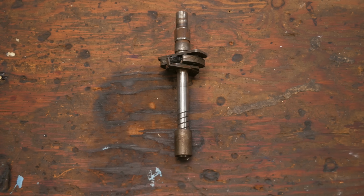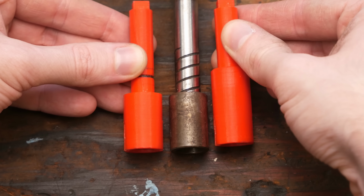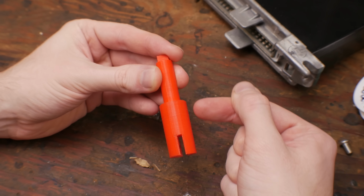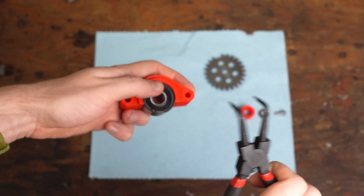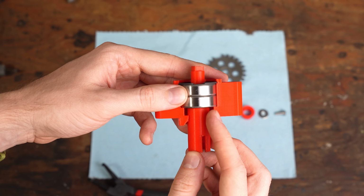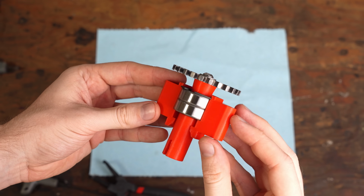Okay, I got it. For some reason, I was dead set on the idea that the base of this shaft needs to be an exact copy of the distributor shaft, but I realized it doesn't. As long as the hole in the slot stay the same size, I can make this however tall I want. So in that case, here is the final prototype. This time, bearings get locked in place with a snap ring, and the taller shoulder of the new shaft butts right up against the inner race of the lower bearing. So no thrust bearing needed, and therefore no wave washer. This thing is rock solid.